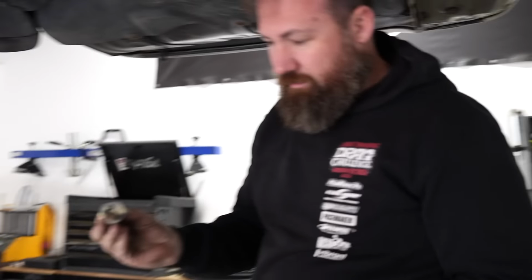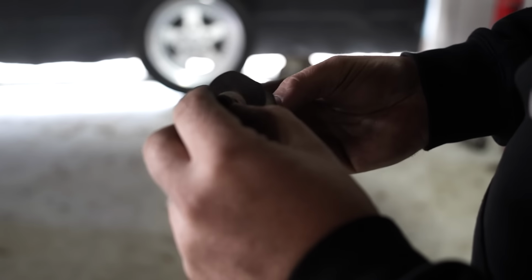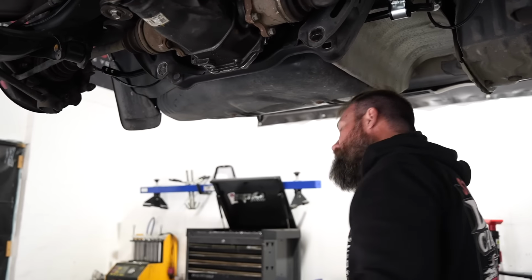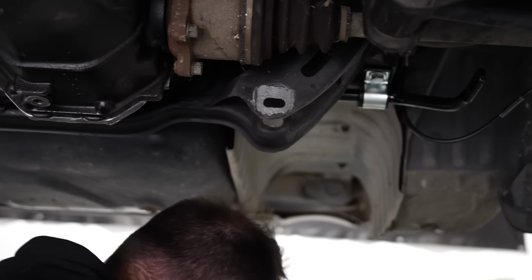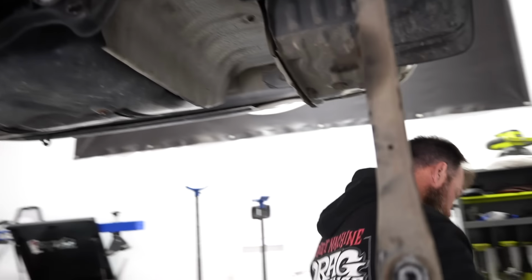Nailed it. So, see these are offset. This is the toe adjuster, which is effectively a cam of sorts. So it moves around and changes the position, the inner position of the arm in these slots. Ah, so that's an alignment thing. Yeah. So it's same, everything's the same except that has the tab, this doesn't. Oh yeah, I guess that marking further explains what you're talking about. Yeah. But this will allow us to be able to adjust the alignment a lot easier and not actually risk damaging the parts. Should move nicely on that anti-seize and then not be a problem.